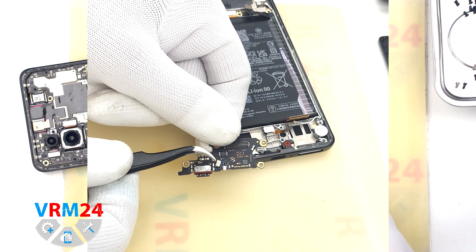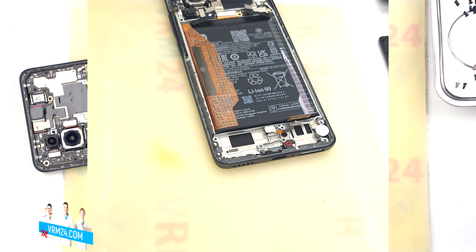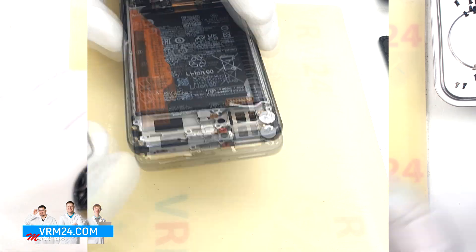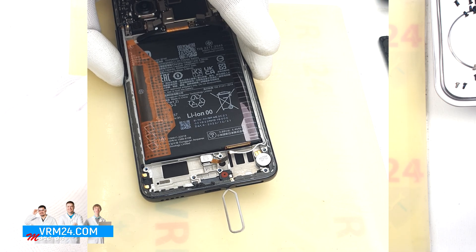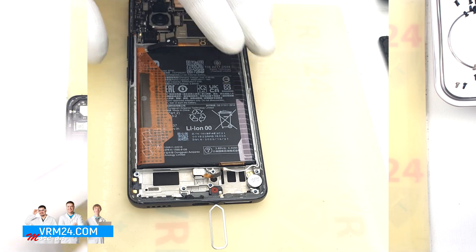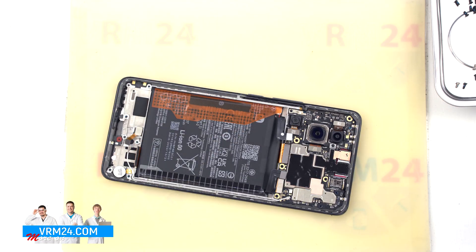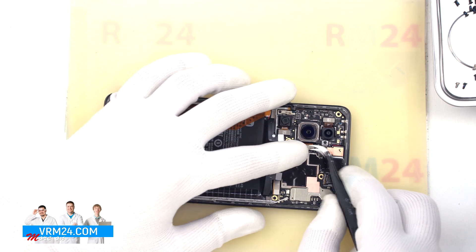On the subboard, we have the microphone, charging port, and the card holder on the back side. And in the display frame, we have the fingerprint sensor and the vibration motor. In our little regular test, we insert the tool into the microphone hole. As we can see, the hole in the display frame has an L-shape. The body of the microphone itself is located on the back side of the subboard. Accordingly, it means that it is almost impossible to damage the microphone in this way.